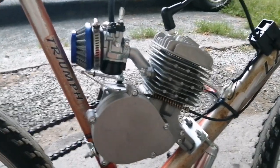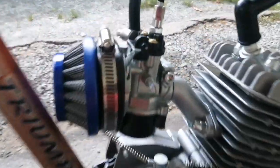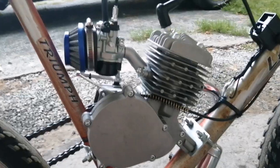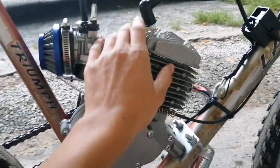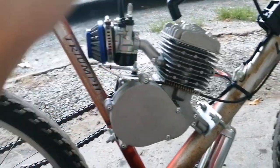Like I stated earlier, once you go ahead and swap that main jet out, you should be pretty much good to go. Just make sure that you install that top cap properly on the throttle slide. Take note that I'm only using this on a pretty much stock engine — it has a little bit of port work, the muffler is slightly gutted, and it has this bolt-on carburetor. So it's not a serious build. As you can tell, it's a trail bike, just judging by the sprocket size.